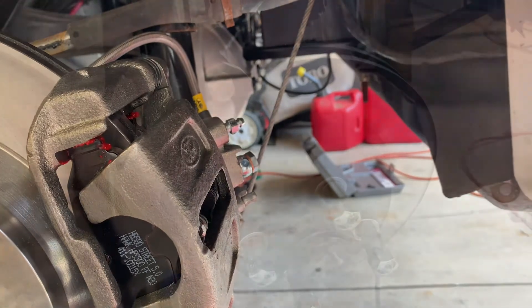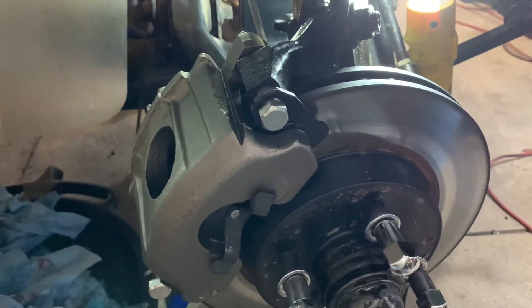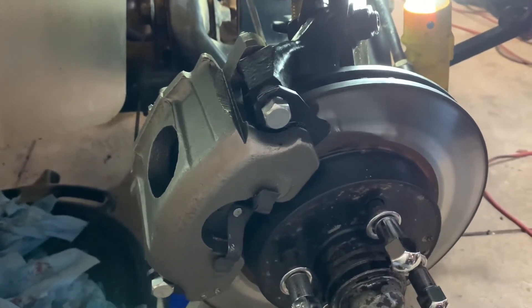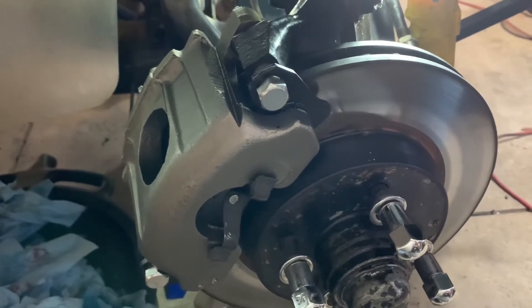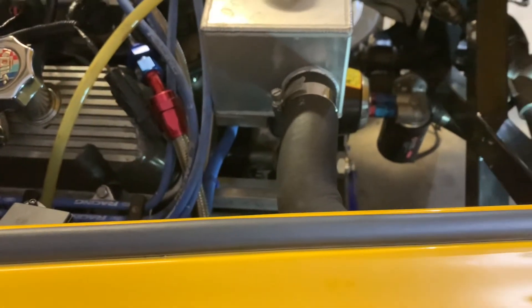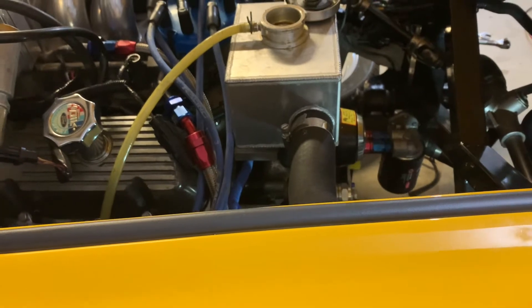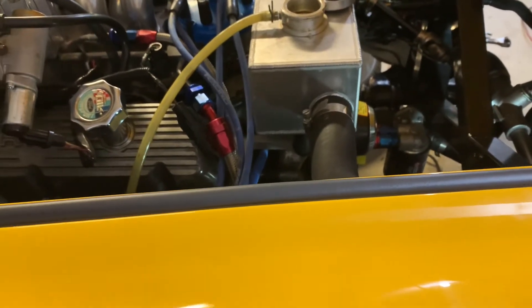Next day — little update. Came out and checked the cooling system; the reservoir was down a little from being topped off yesterday. Looked around the top of the water pump and in the pockets by the timing cover — I did see a little bit of coolant sitting on one side, possibly a tiny bit of runoff seepage from the thermostat housing. I was able to put a little more snugness on the two bolts, so I tightened those up. I'm going to monitor that and see what happens.